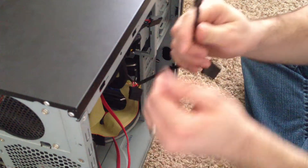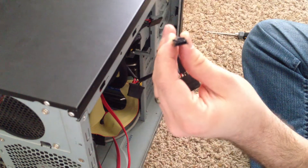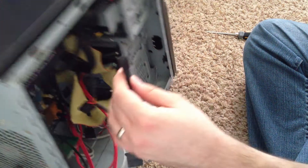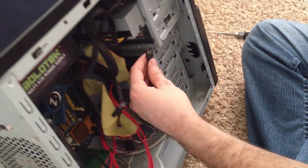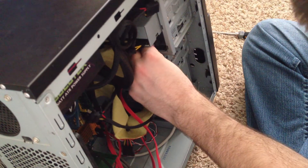The floppy drive uses a special 4-pin power cable. Like I said earlier, it's called a Berg connector — B-E-R-G. You'll notice it has a special orientation on there, and that fits in one direction on the back of the floppy drive. With these two long outer pieces, it should go right down to the bottom of it.